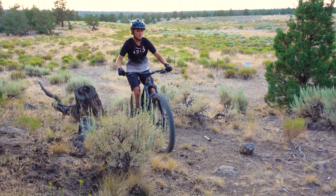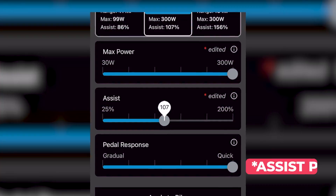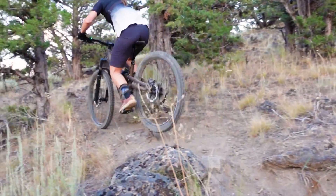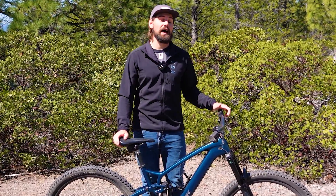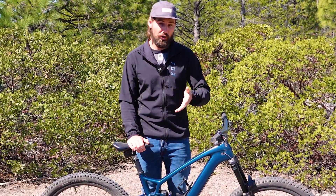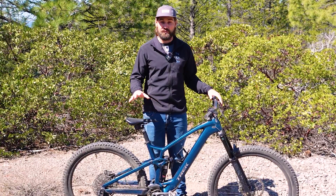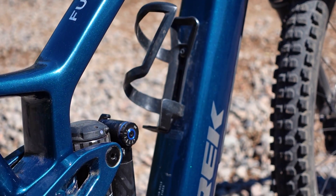Next, Miss Grip and Rip, who loves a challenging climb just as much as a fast descent. For her technical single track trails, we'll bring assist down to 100% for a more natural feel, and lower pedal response to help ensure she doesn't lose traction climbing slick routes or loose switchbacks. Lastly, we'll slide max power all the way up to 300 watts, meaning she can rely on that one-to-one ratio regardless of how much effort she puts through the pedals. Both custom setups lie between the upper and lower limits of the TQ settings, so they're adaptations of the mid mode.